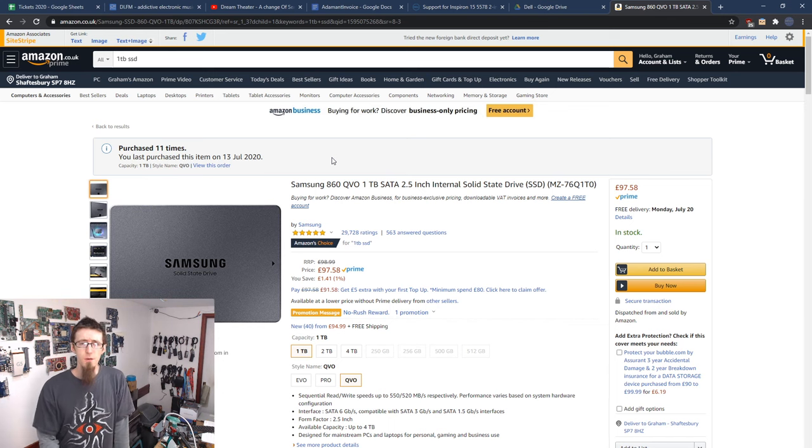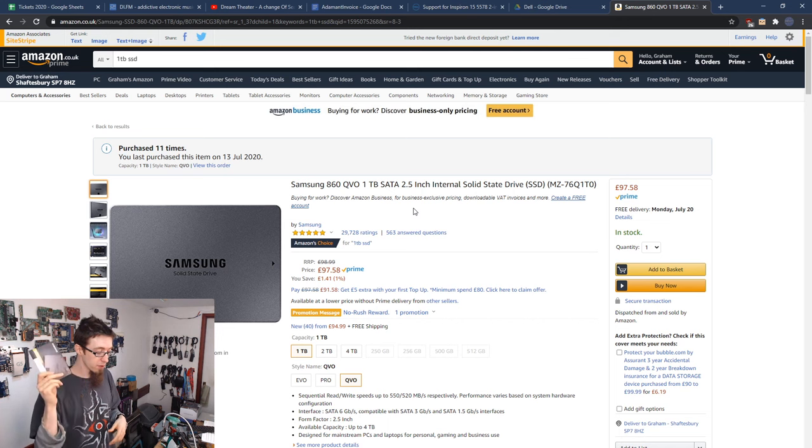Anyway, so here's your options there. I would personally put an SSD in it if it were my Xbox. However, it's not mine, it's not up to me. For the sake of this video, because I happen to already have one of these SSDs, because I keep these in stock, I'm going to put this in it just as a demonstration, and we're going to fit this to it, restore the system software, and get this Xbox back into working condition, just so I can show you what that would look like. I'm not actually sure what it looks like myself, so we're going to learn together.